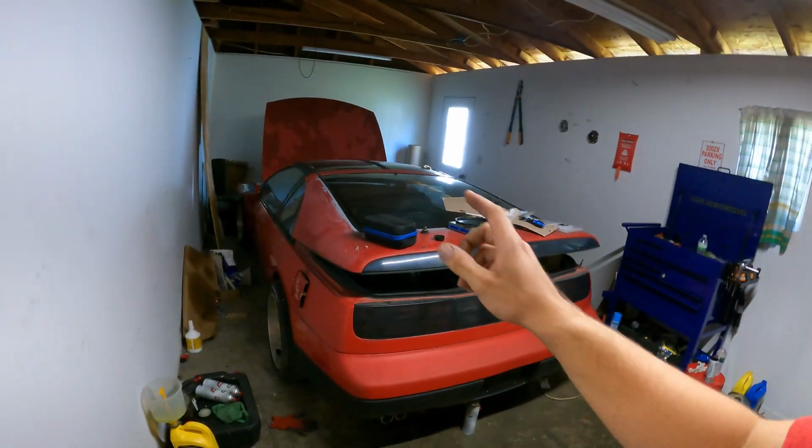Not only are we going to be doing that, we're actually going to be coming back to the house. We're going to be starting over here on Blade & Z. We're going to do some compression tests with some oil in the cylinder, see if it jumps up, because we did test it previously and it's rather low. I will say it's pretty even on the spectrum of compression tests, but we want to see if it's the rings or if we have a valve issue, because if it's a valve issue, we can replace the heads, no big deal, but when it comes to rebuilding the bottom end, a little more finicky and a little more expensive, actually a lot more.